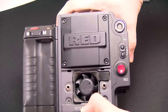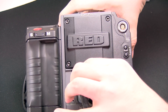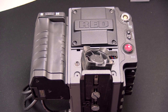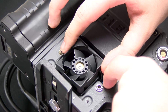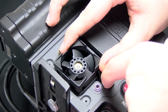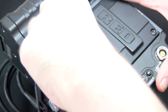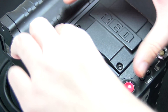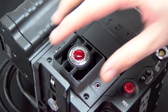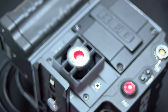You can see how thin this one is. Now we've got our fan just sitting right there, and what we're going to do is pull this out, just like that, off to the side. We will use the included spudger to unplug that cable. Now all we have to do is plug it right in — just squeeze the fan in there. We kind of have to fold these wires a little bit to get them to fit. We can cover our flap up, then take our new front cover and put that down. You have to put the teeth in first, and then squeeze that on over just like that. And just like that, we've got our new front on. I'll go ahead and put the new screws they included into the camera.